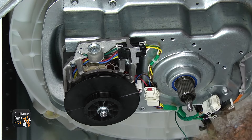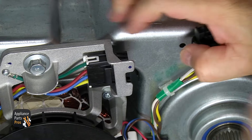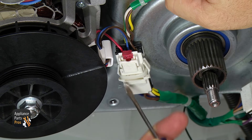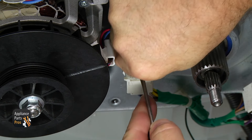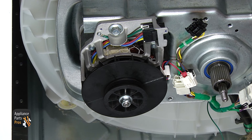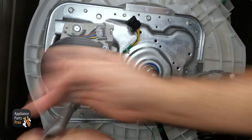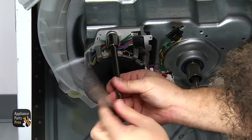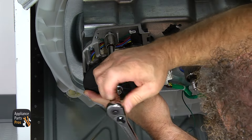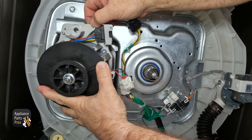Now we're going to remove the drive motor. First, we're going to take off the wiring harnesses. We're going to disconnect the motor one — use the small flathead screwdriver and press on the locking tab and pull it out. Then we can do the speed sensor one. This one has a locking tab — first use the screwdriver to lift up on the locking tab, then press on the locking tab down here and pull it off. Once you have those free, grab the ratchet with the extension and a half-inch socket to take out the bolts that hold the motor on. Once you start to loosen up the second one, hold the motor up while you take it out. Once you have the bolt out, carefully pull the motor out and set it aside.